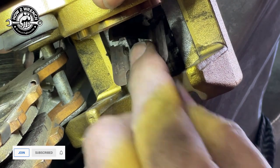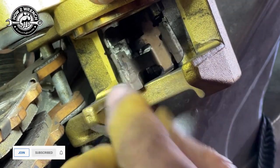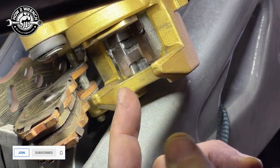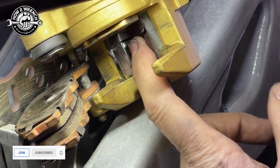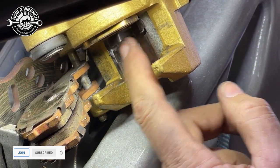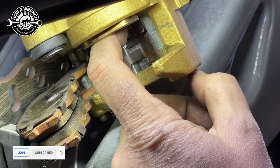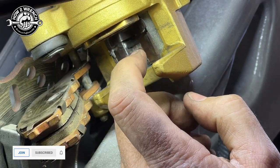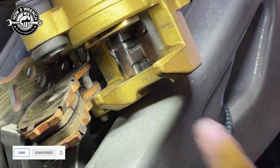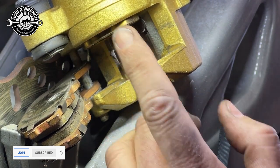What's important is it has a little tiny retainer right there for the back pad. On that customer's bike that came in the other day, this retainer was in the wrong position — it was a brand-new brake job. This piece will fit in here either way, so the mechanic did the job, maybe it fell out and they flipped it around. As soon as the customer started using the bike, the caliper would push on that brake pad and when you let off it lets off ever so slightly. If you haven't seen my video on caliper cutaways I'll put a link below.